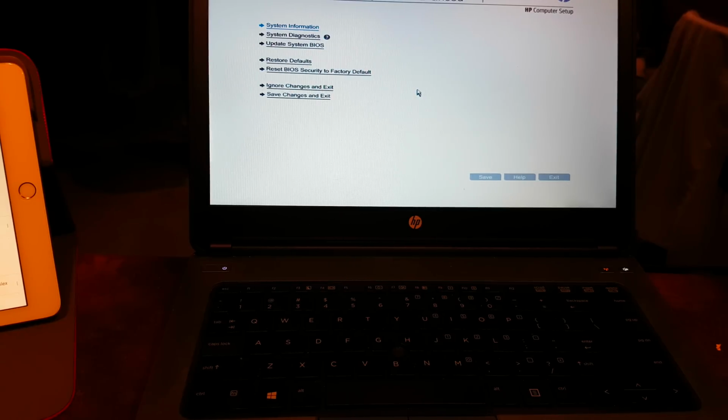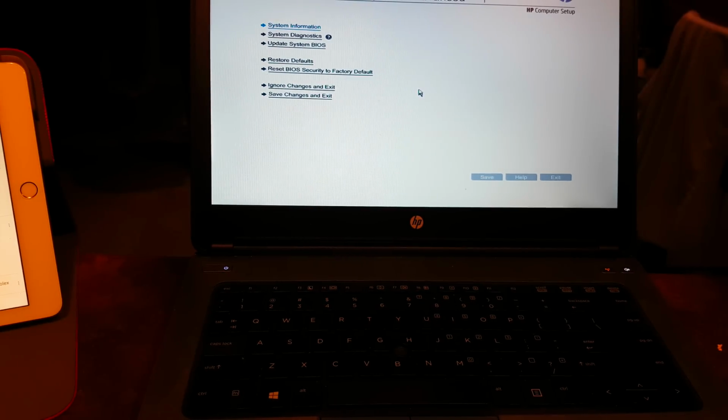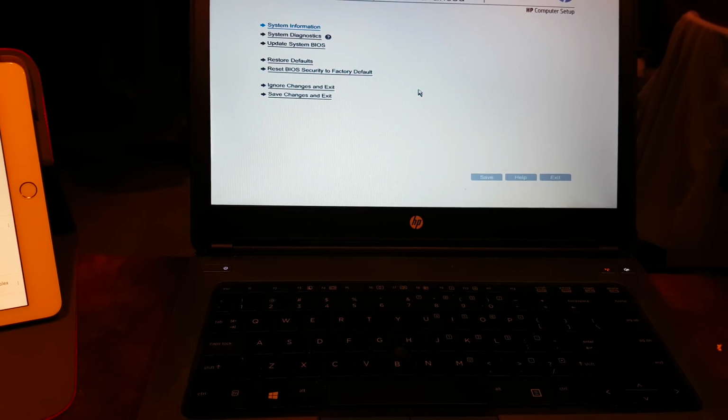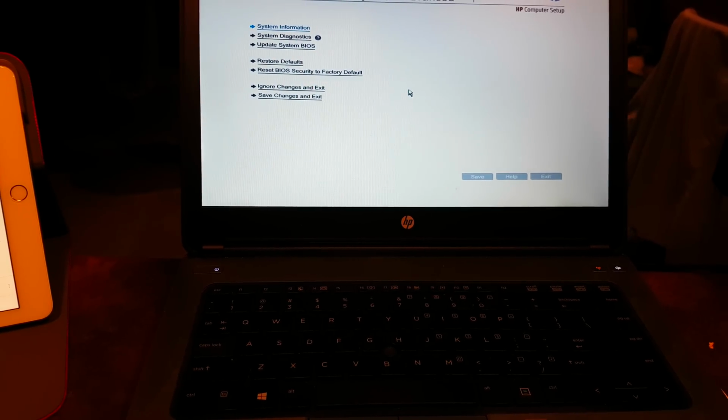It works. This is the only legitimate way to clear the BIOS password, because the password itself is not exposed, so corporations' security is not exposed. You can just clear the password. And also the data, if it's a corporate laptop and for some reason there was a hard drive in there, the data is safe, because as soon as you reset the BIOS password, the BitLocker encrypted hard drive becomes unusable. All the data becomes trash. The only thing you can do is just reformat it. So it's pretty safe for everyone. It's a win-win solution. For some reason I didn't have this description anywhere.